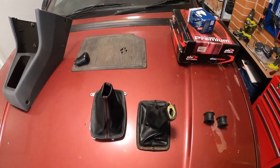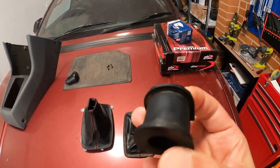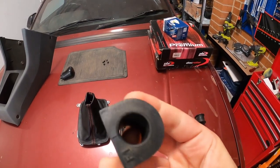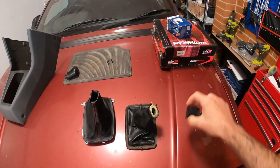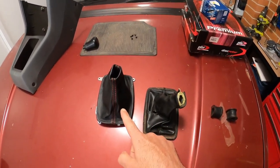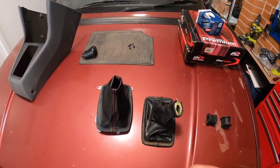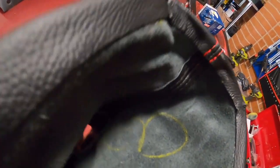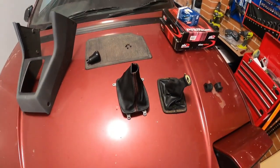And the sway bar bushing — sadly, they said it's gonna take a month to get them, so I had to cancel that order. But these are the ones that I already have. I managed to clean them up and they turned out to be all right — it's not completely clean but it's not dry, there are no tears in it. All I need to do is just grease it up and it's good to go. So here's what I'm gonna do — we're gonna put this one back and replace with this one. Now to replace this one, there's a trick. You see this plastic piece? You need to remove it from here and install it over here. You might need some glue, or some people use an o-ring — a rubber thing you can tie from the bottom. Or you can just use a zip tie. Probably the best JDM process is to use a zip tie and just zip it up.